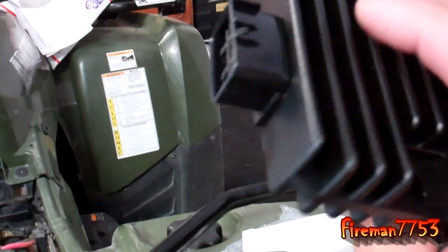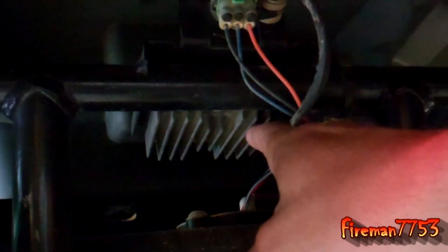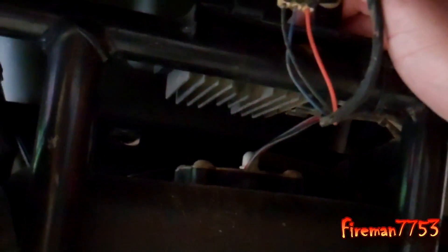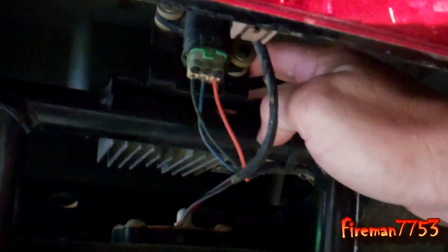So I bought a new voltage regulator and I'm getting ready to put it in today. Here's what it looks like for this unit. If you go under the back of the four-wheeler, it sits right here. The only thing that holds it in there is on top — there are two 10mm nuts that you have to take loose to drop this thing down. I'm going to go ahead and get it dropped down and see if we can get it swapped out.